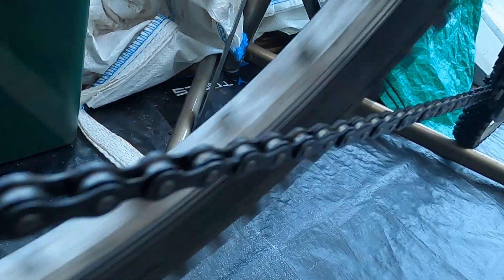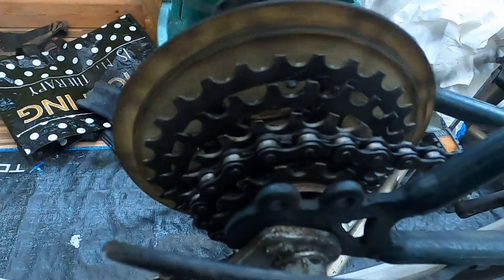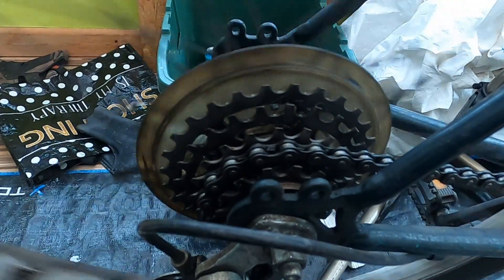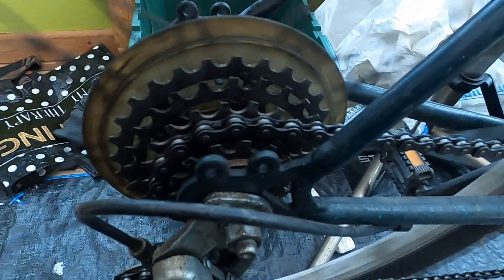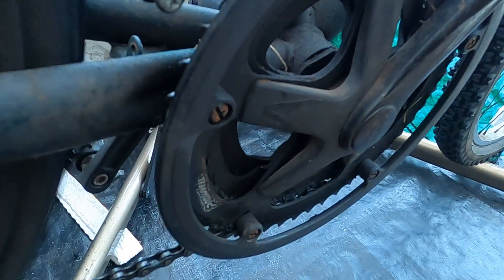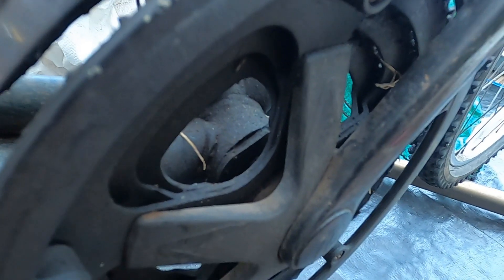Does it still go round? Yes. There is one weird thing though — the freehub does a little dance as the wheel goes around, you can see it moving and doing a little jig. I need to sort out the cup and cone bearings but they're not too bad for 25 years old. There's a little bit of play in the bottom bracket — it might be cup and cone so I might be able to sort something out. Can anyone tell me what tool I need to get this bottom bracket serviced?